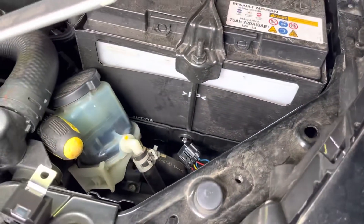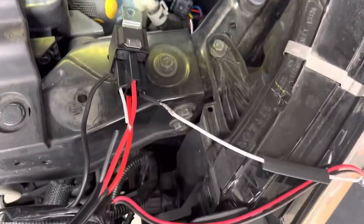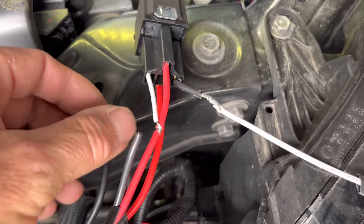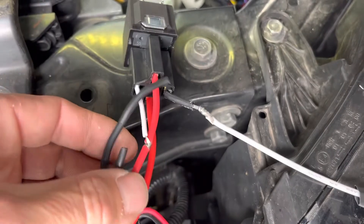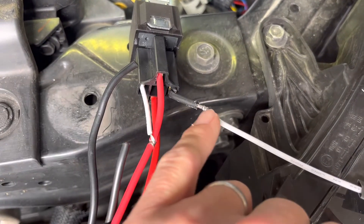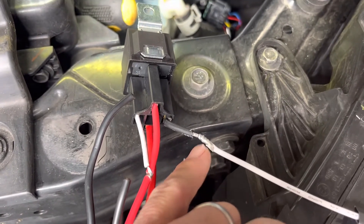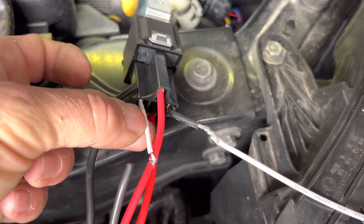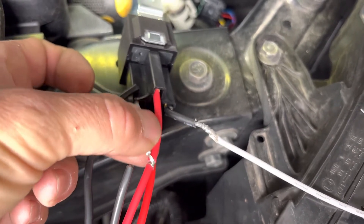The universal King's light bar wiring harness only works on positive, so what you need to do is on the wiring harness — that earth was connected to the battery earth and your light bar earth. Cut those two off and put them on a separate earth point on the chassis or battery if it reaches. This is now your negative trigger via your switch from the high beam. The high beam negative is now clicking in your relay on pin 85, and then on pin 86 — which was the original high beam trigger for the positive side — you just bridge that to pin 30, which is your battery.